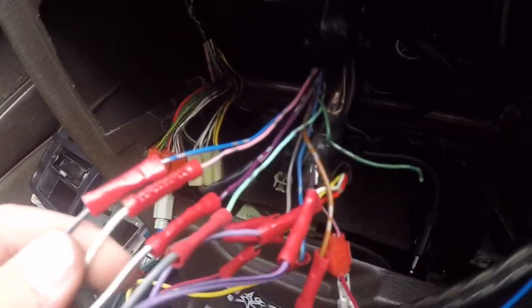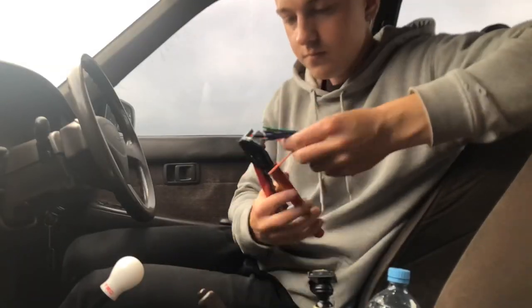I've figured out my plan of attack. Rather than cutting behind the crimps — which was confusing me because the colors on these wires don't match my new harness — I'm going to cut all the wires off the old plug and then crimp and connect them directly to the new harness. The wires on the car side are pretty much the same as the wires on the new harness, so color-matching them is really all there is to it.